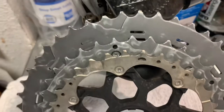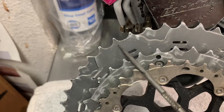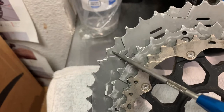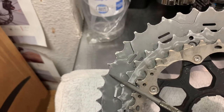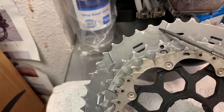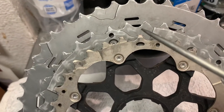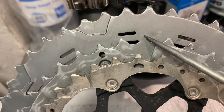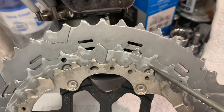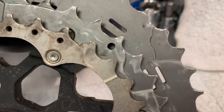I'm going to prop it up here, so ignore the noise. One thing you'll start to see is there should be different profiling for each of the teeth — that's normal. But at a certain point when the chain has worn into this so badly, it's almost like the tooth is actually gone. This is obviously a climbing cog — this is an 11-46 cassette. And here you can see the same thing on these teeth. They're worn very irregularly now because the chain, instead of falling directly here in this trough, this valley between the two teeth, it's now falling on the sides of the teeth, and you can see how sharp this one is.